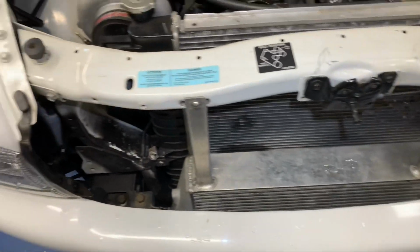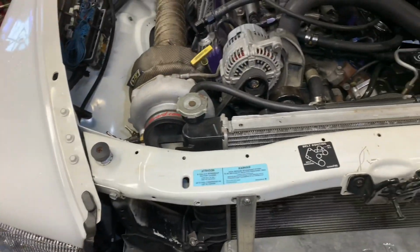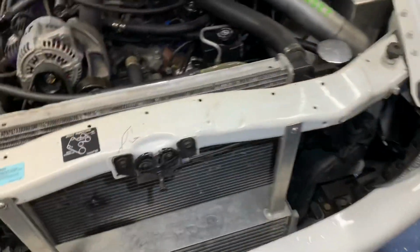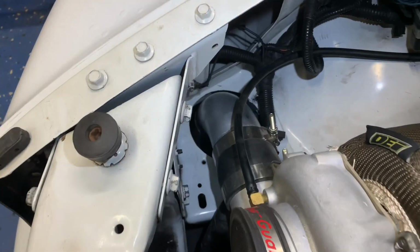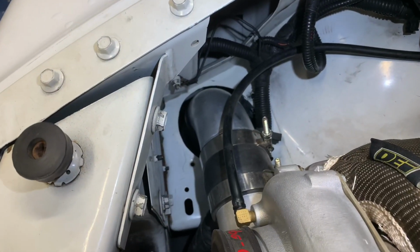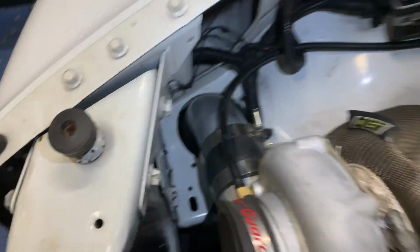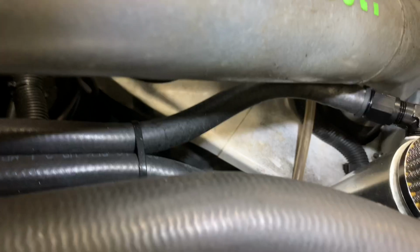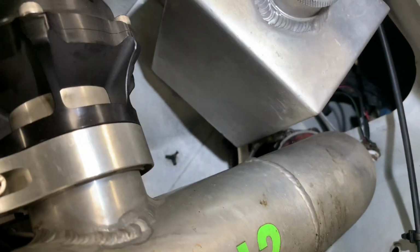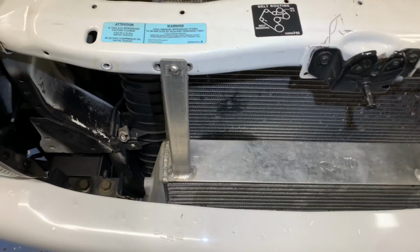Intercooler came from Treadstone. I did fabricate all the pipe work in and back out. That's all my welds. If you're curious and you want to turbo your Dakota, what I did is I actually did about a 4-inch hole saw through there, and then relocated my battery with another 4-inch, so you can see it, 4-inch hole saw through that fender, and then it just ties into this Treadstone intercooler.